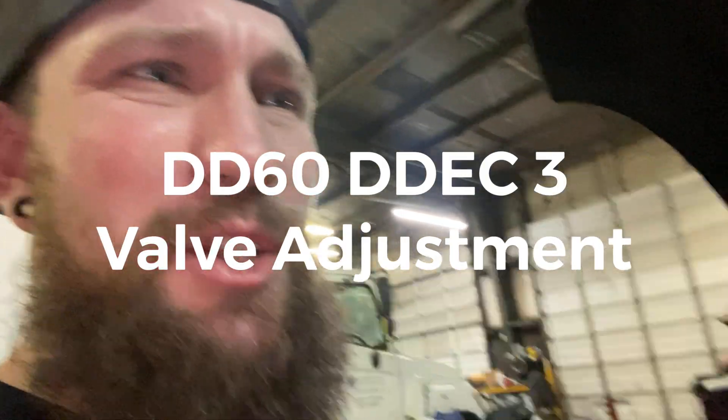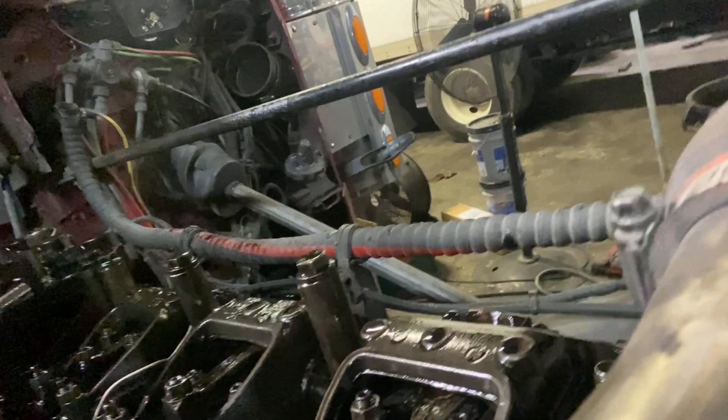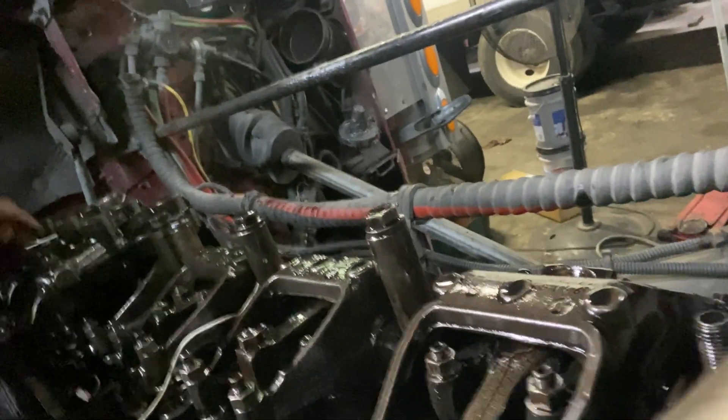For a quick comparison before I remove the rear jake box, I wanted to show you the spacers I was mentioning. If you look at the jake itself, under this side right here, you have these spacers that hold it up. Whenever you remove the actual jake box itself, you're gonna take those spacers and utilize them — put them right here with the original bolts. What we're doing is actually locking down this rocker assembly. We have to have it locked back down whenever we do overhead on it. You want to torque those to 90 foot pounds.